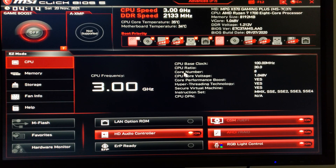And here we are at the BIOS of the motherboard — everything's been installed. Hope you guys enjoyed that quick installation of the board onto the BeQuiet 500 computer case, which I've had for some time and used for hardware testing. This board does support the first-generation AMD Ryzen CPU, as you can see noted in this area. I did go ahead and install 8 gigabytes of RAM — unfortunately I put them in the wrong slots. If anyone caught that, good eye. No big deal, I'm just using this for test purposes.